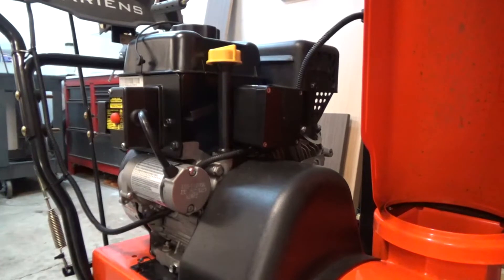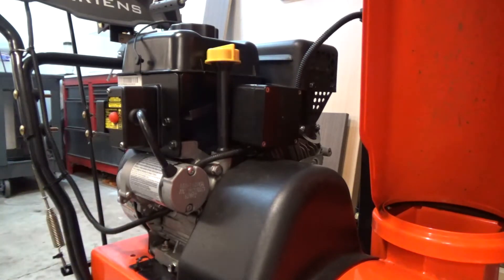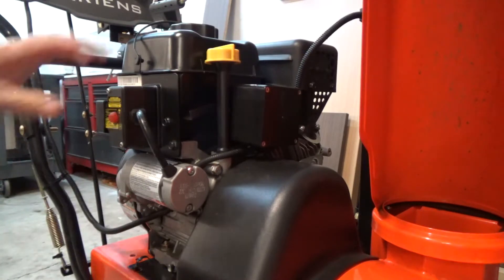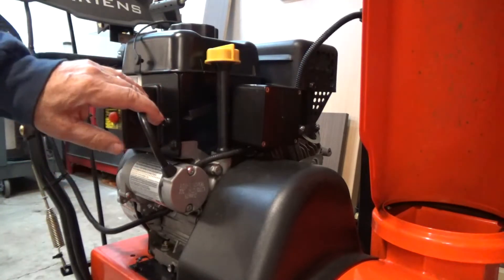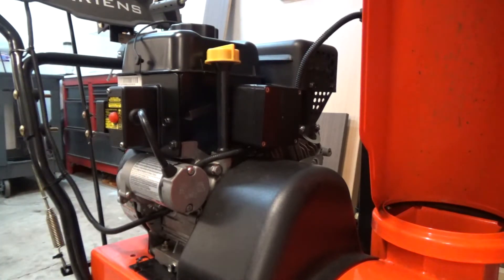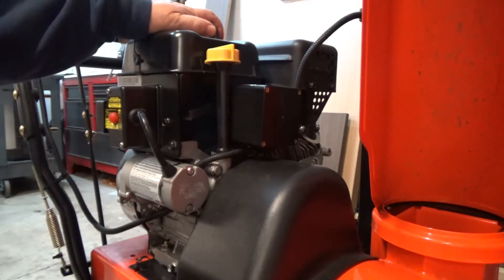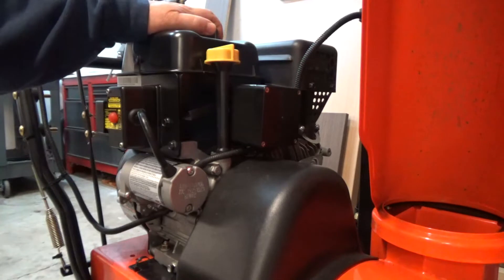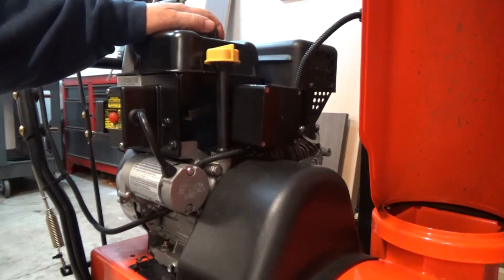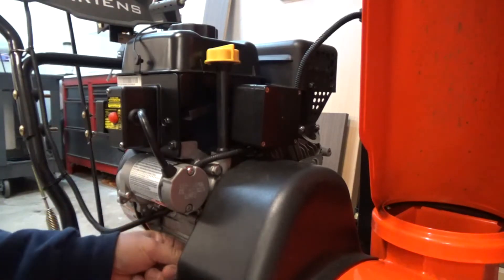It's still mid-November right now, and I'm actually making preparations for the snowblower for winter. Put away my lawn mower, took out the snow blower, and I'm going through it. I store it with no fuel — there's a drain on the carburetor, so I just drain all the fuel out of it. I'll have to start it up and fire it up to make sure everything's working; I just need a real cold morning.